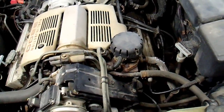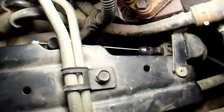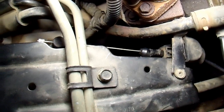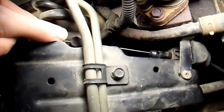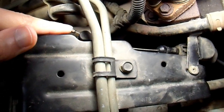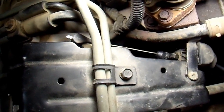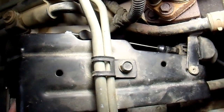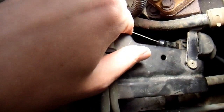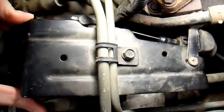In any case, I'll show you here how to quickly adjust this. As far as car modifications go, this is about as low risk and as easy as you can possibly get. You just pop open the hood any time and adjust it. You can see here that this cable is pulled out of the transmission about this far when the throttle is completely closed, and I have to open the throttle about to here before it starts pulling on the cable. Normally, this would be up tight against here, pushed into the transmission. But I have it adjusted so that it's a little bit looser.